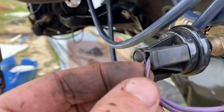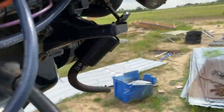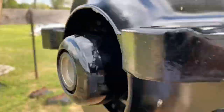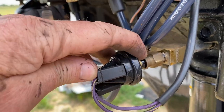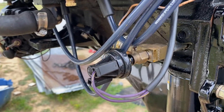This purple wire is a run wire which feeds ignition power and feeds power to your fuel pump. It also feeds this purple/yellow right here at the oil switch. So when in starting mode, that purple/yellow goes to ignition and makes the engine run while you're cranking. Once you're finished cranking and the starter drops out, the oil pressure switch should be made by then.